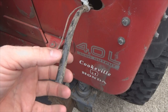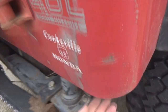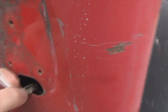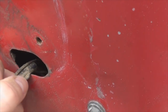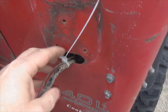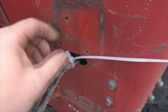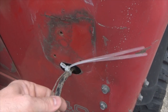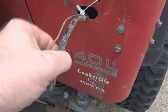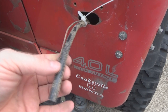As soon as I cut that light off, this fell down inside there. So I had to take my hand, stick it up inside there, push it back up through this hole, and right here's a little flat spot on the wiring harness. I hung it on that and walked off. It fell back in again. So here's your trick. Get your wire tie, loosely wrap it around that, and just leave the tail sticking out here. That prevents it from sliding down inside there. So now we can cut the protective jacket back here and get to our wiring and start our wiring on this side.